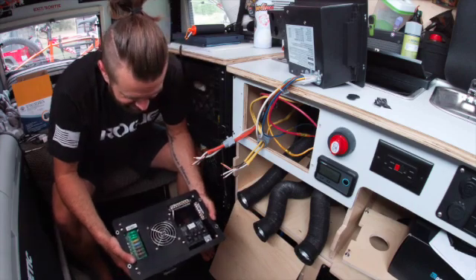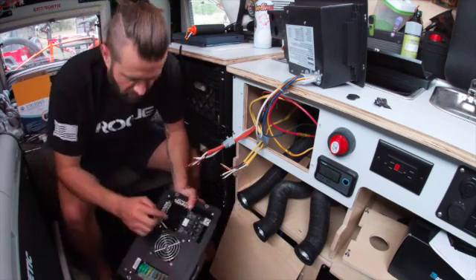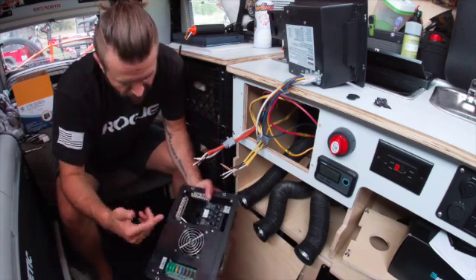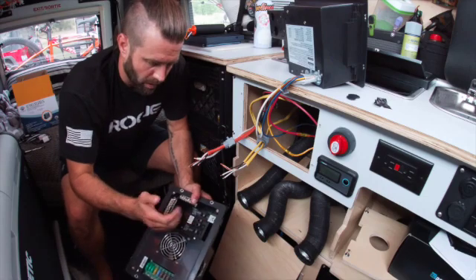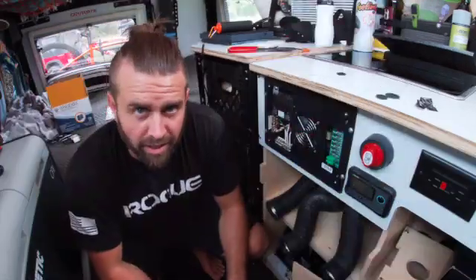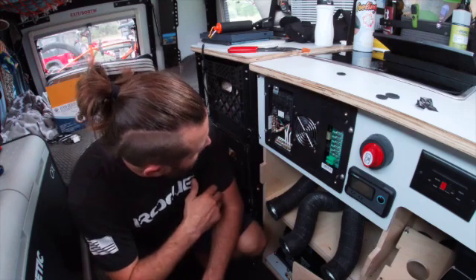Got the box out. When dealing with 110 wiring, the wire and cables are a lot more rigid, so it's not quite as easy to pull things apart — just be aware of that. What I found easiest is disconnecting at each breaker — the ground and the common — and then pulling it out as a unit once all the wiring is straight. I'm going to feed it in the same way, hooking up the breaker side first, then securing the breaker. I'll pop this out, swap out some fuses, get that into the new panel, and start getting everything hooked up. It's all in, bolted down, all wire connections are tight, and I double-checked my pictures I took before to make sure everything's in correctly.